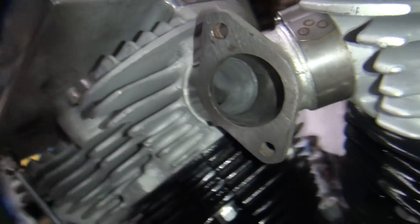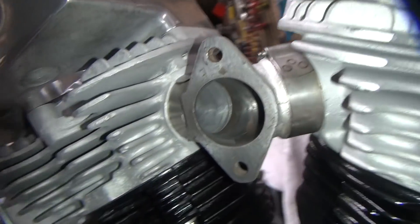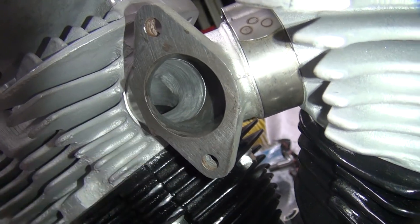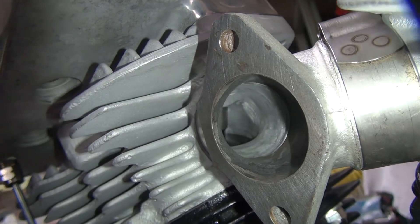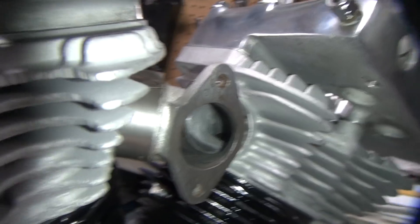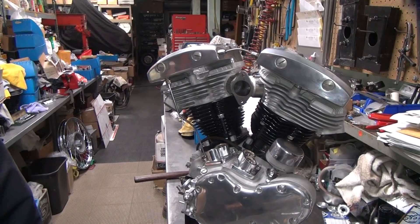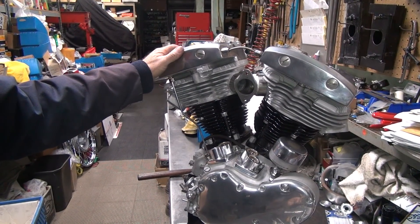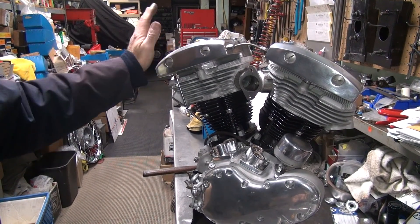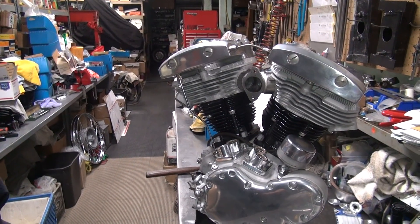Got a little bit of a loop on the back side there. The angle is pretty even. You can see how the porting cleans it up — knocks off those edges so the air will flow in there really nice. You can see right up in there the way you're supposed to, you can see the valves. So that should run pretty damn nice. That's how you get all that stuff buttoned up in there — it's not a major amount of work, but it does matter how you do things. Let me get my hands cleaned up and we'll do the valves.